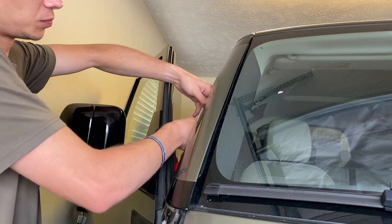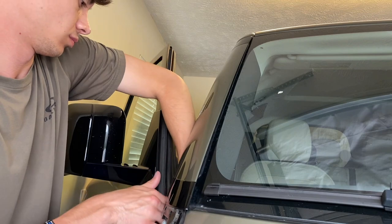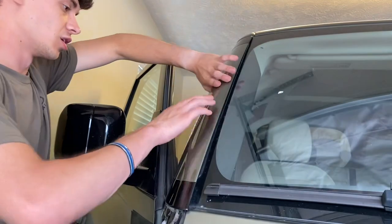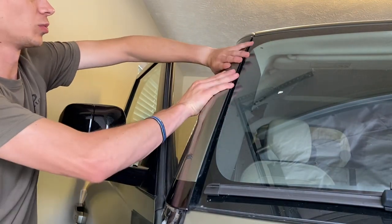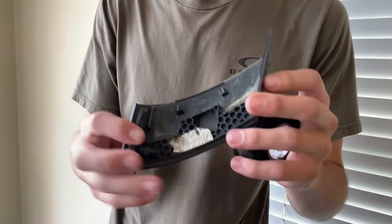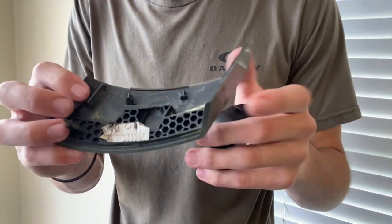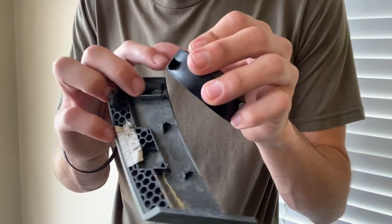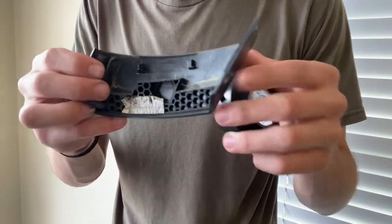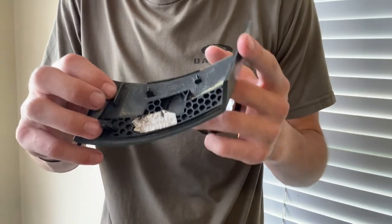And then for the back side, pull out that red piece as well. And for the back, it should already be touching, but you always want to at least apply a little bit of extra pressure just to make sure. And then the last thing for this trim piece right here, you'll see it's got this clip that actually goes into the front. And what I like to do is just go ahead and wrap it with half a line of tape, just so we get a little bit of extra traction on it. I don't know if this could make any of the noise, but there's a chance that it might. So I want to go ahead and address it while we have it off.